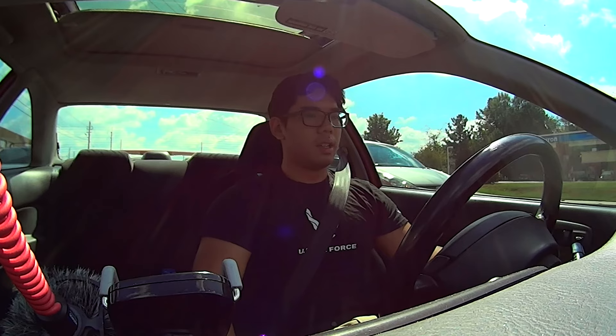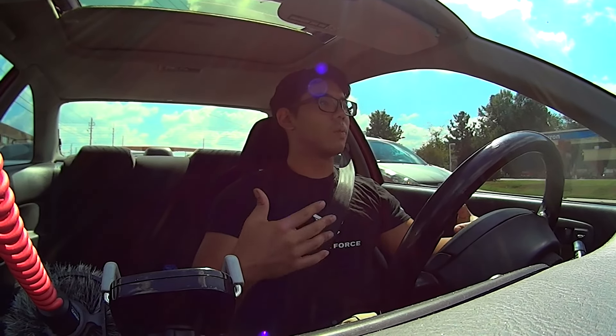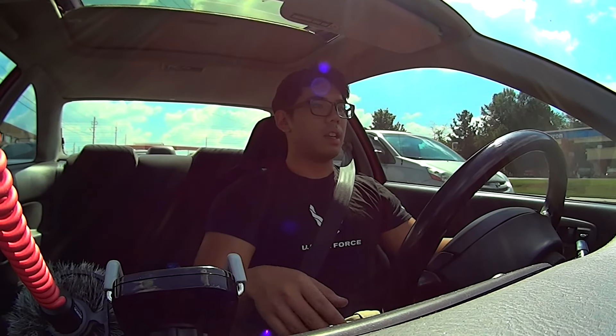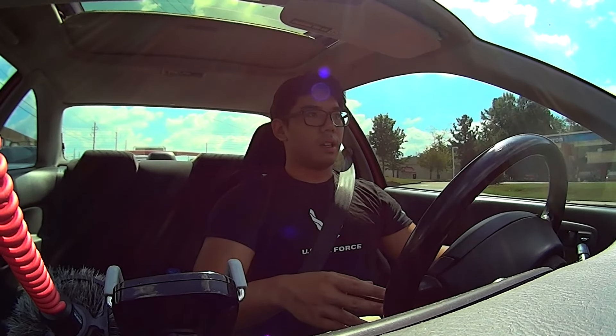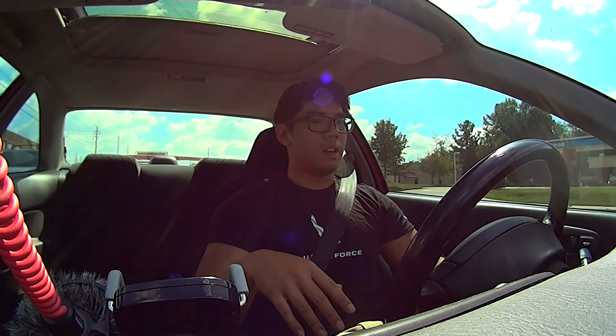From the camera you're probably going to pick up a lot of vibrations from the new mounts. From what I can tell the hood was rattling at a certain point, but I think it's settled out. You really notice the mounts when your AC clutch kicks in — it drops your RPMs a little bit and from that it just shakes the car a lot more. There's a very visceral and raw feel to that, so if you like that from a car and just want a more exciting daily driver, this is something you might want to consider.